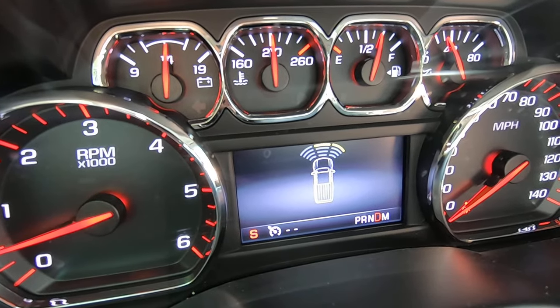The main objective of this video was to show that you can download a dB meter or sound meter app to test your parking assist sensors. You've got to make sure your system is activated — on this truck it has to be running and either in reverse or drive for the system to be active. If you're in park, you're not going to get anything. You guys take care.